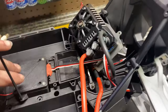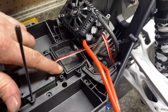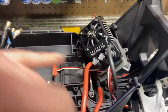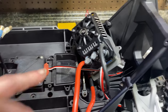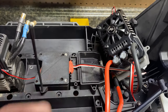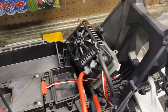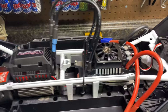You can run your power wire from the ESC around the side or however you want. Up in the front, I actually took a rat tail file and cut a little groove for my wire to run under and through. I wrapped everything and made a little channel for it to run across through the factory receiver box area — I thought that was the cleanest run for my wires.